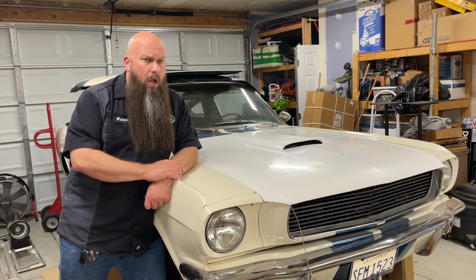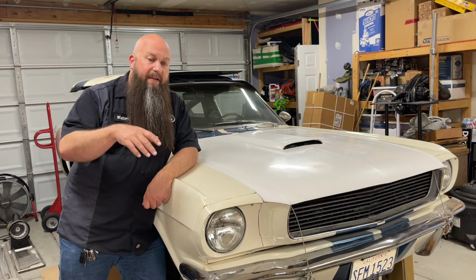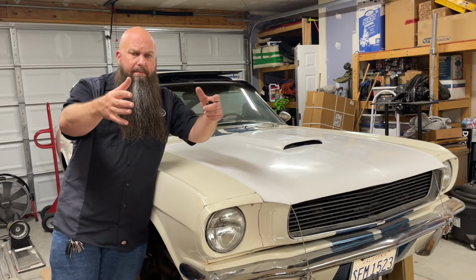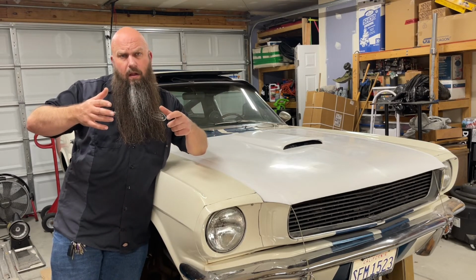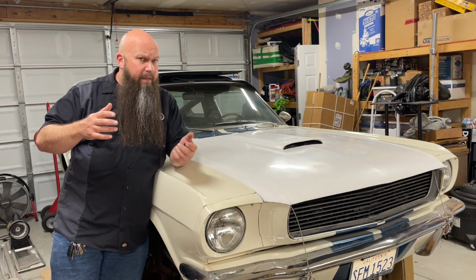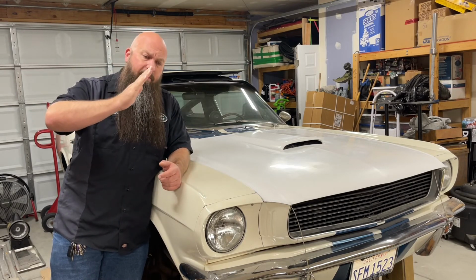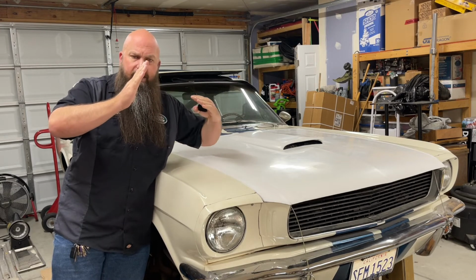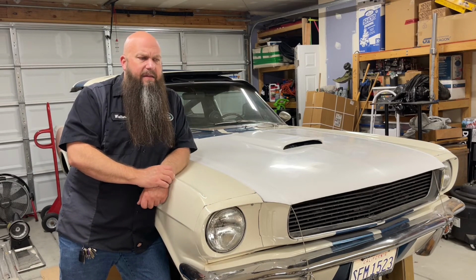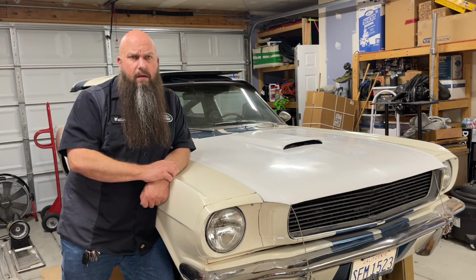If you do it with the bell housing on the transmission, you have to be a little more careful. You're going to pull the bell housing off. It's going to make the transmission nose heavy. And then you have to pull the whole assembly back almost until it touches the firewall. At that point, you have to lower it down, and you really need somebody to give you a hand and tilt the motor a little bit so that the engine comes back and you get a little bit of angle on it so that it slides off and then everything drops out. Once you've done that, you've gotten it out of there, again, get it out of your way and you're done. Transmission's out of the car.